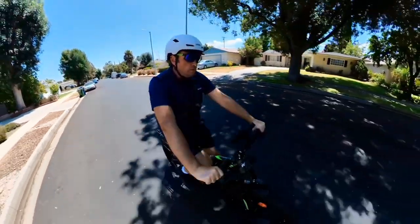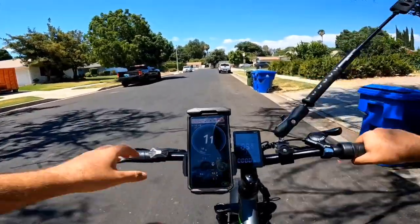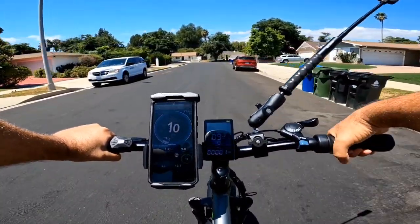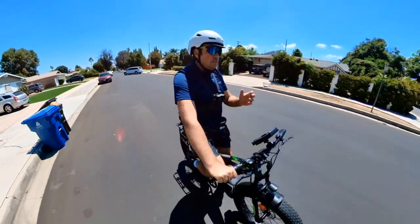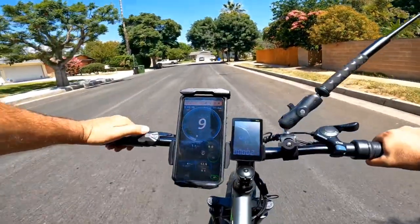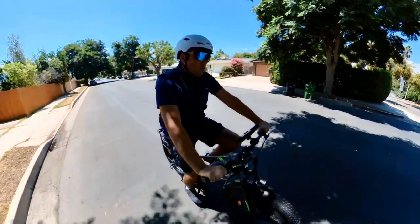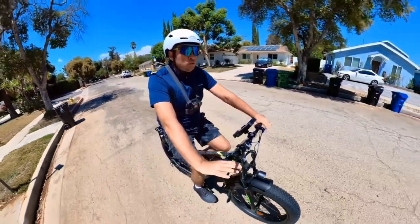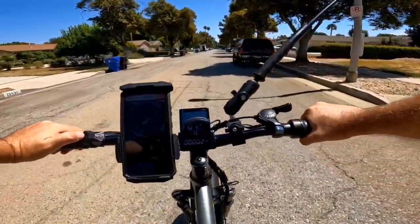With the power off at zero, I'm going about 10 miles per hour. I can feel some resistance because the tires are fat — I have about 17 PSI on the rear and 15 on the front, with a maximum of 20 PSI. There's a safety feature: at PAS level zero, the throttle and pedal assist will not work. You have to switch to PAS level one through five to use the throttle, and the throttle speed depends on the pedal assist level.